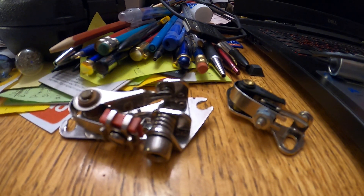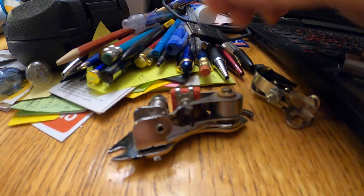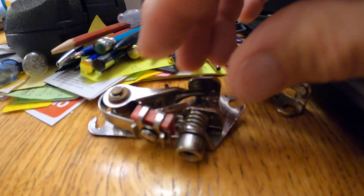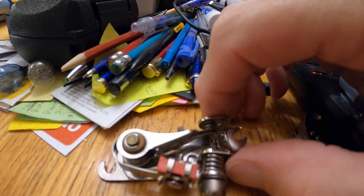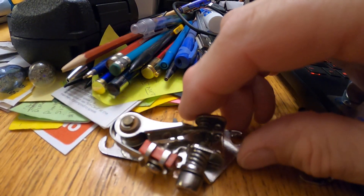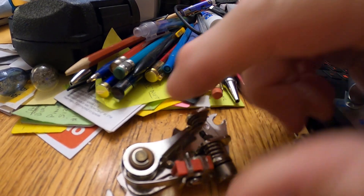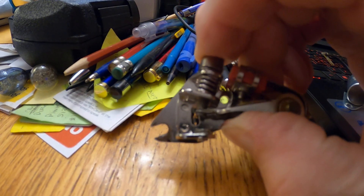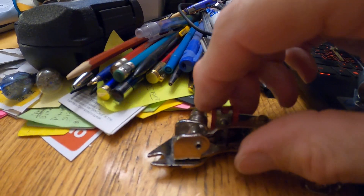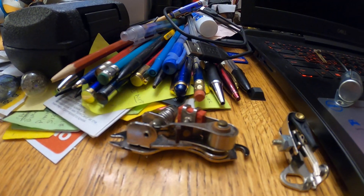Now it's all electronic ignition — you don't even have a distributor anymore. This version here is what we used to have in the General Motors cars. What was neat about it is you mounted it down, and if you needed to adjust it you just turned this set screw — it's a hex, so you put your allen wrench in it and adjusted it while the engine was running. You'd put a dwell meter across your coil wire and the dwell should have been 30 degrees on these. It moves the whole point arrangement back and forth. You didn't have to set the gap with a feeler gauge like on the Ford products. I could get 20-some thousand miles out of these.